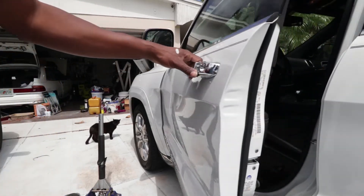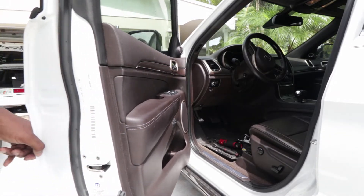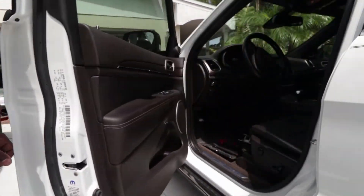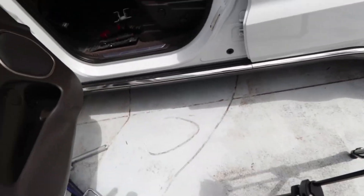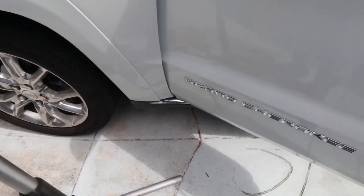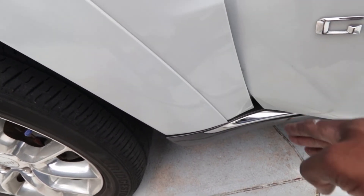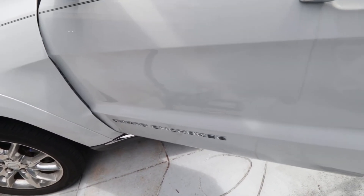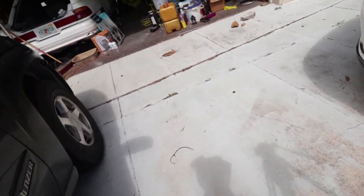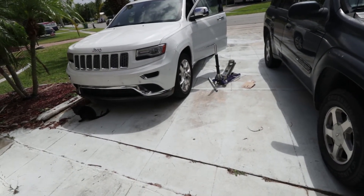There we go — nice door that will stay open and will not crush your legs. Three positions of openness. Alright, there you go, easy peasy. Just a recap of things to be mindful of: when you have that bottom hinge off and you're moving the door around, be mindful that the door may come in contact with the fender. You should have a piece of foam or something between the door and the fender to keep it from doing what I did. Because now I get to go to my wife and say, 'Hey, good news: I fixed the door hinge. Bad news: I scratched the paint on your Jeep.' So maybe next video I'll show you how to apply touch-up paint correctly. I think we'll leave it at that — until next time, guys.